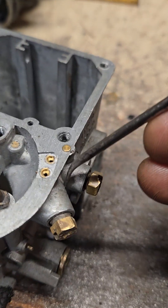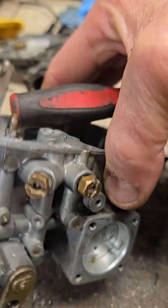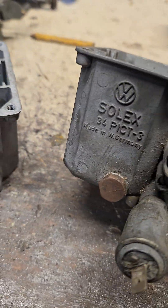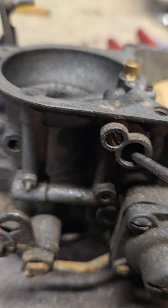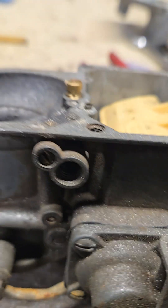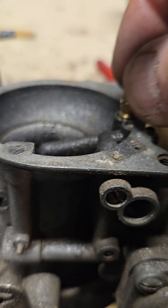A bigger pilot jet probably won't be enough on its own — you're also going to need to drill this hole out to two millimeters. This is a dual port carburetor. It looks just like a '70; if it's German with the same style, that's a '70-only carburetor. On the dual port, we've got two jets: this is an auxiliary idle jet, and this is for the pilot jet. There's a plug and a tiny jet — don't take it out, just leave it alone; it's too small to touch. This is the air correction jet for the pilot jet, and this is the air correction jet for the main jet.